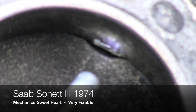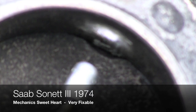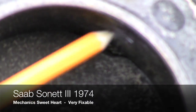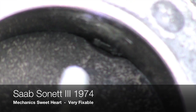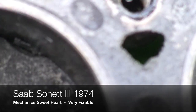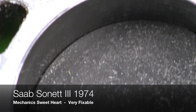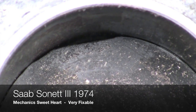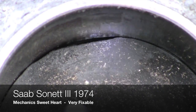It's gone down there — it's kind of melted up a little bit against the cylinder wall on the top. The heat is on the top when it's in its compression stroke; there's the most volatile fuel situation at that time. The scoring on the cylinder wall is not so bad — it seems like this happened pretty quick and not over a long period of time, to gouge up the cylinders. It just burned out the softer, most burnable metals — which is the aluminum piston. We've got a burn on this side and equally a burn in the same type of location on the other side. That of course is not going to provide for any compression.